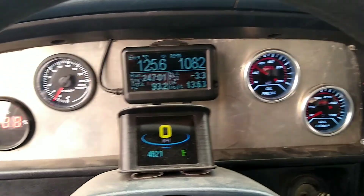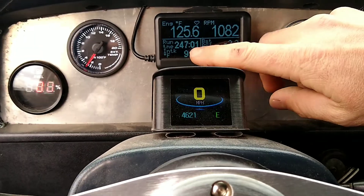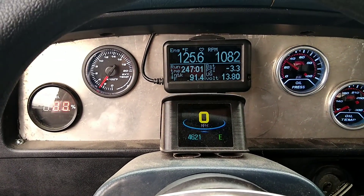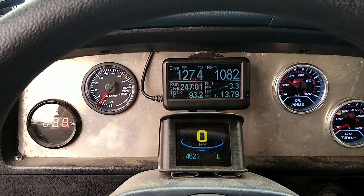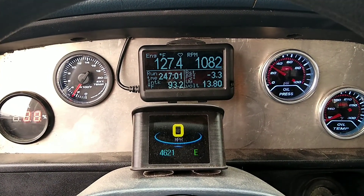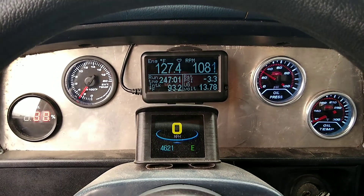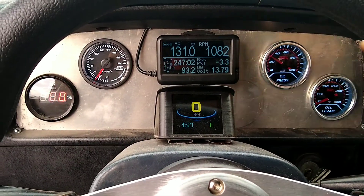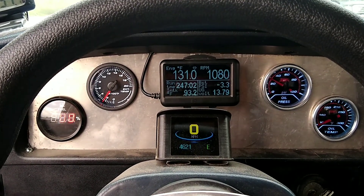It might be windy and it's hot so I've got the windows down. I'll show you what we're reading everywhere. The intake air temps can get pretty warm, but I haven't decided what I want to do there — whether we want to do some water-meth injection or even just wetting the intercooler while we're driving. But let's see what she's got with this load. Looking at the boost here, you're going to want to add that to whatever the boost reading is.